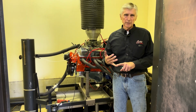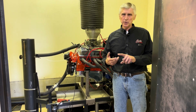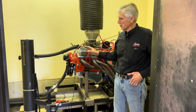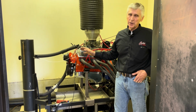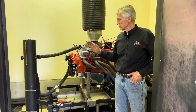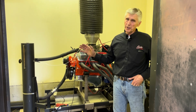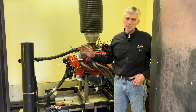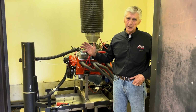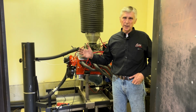We've actually tried everywhere from 34 to 38 degrees timing. We've changed fuel air ratio. We've changed jets. We're probably pretty close to what we're going to get with this where the camshaft is. The camshaft's right on center line at 104 degrees right now. You can always play for a few more, but we're at 345 horsepower, and we've made 400 foot-pounds of torque. We wanted more than that, but realistically, if 3 or 4 cylinders aren't pulling their weight, you're not going to get maximum power.